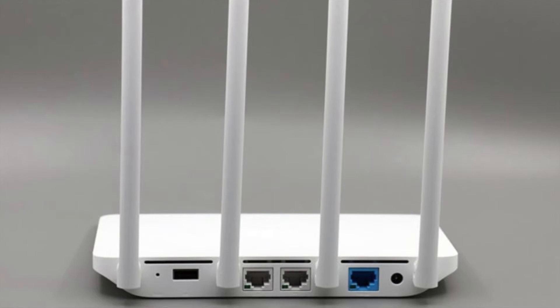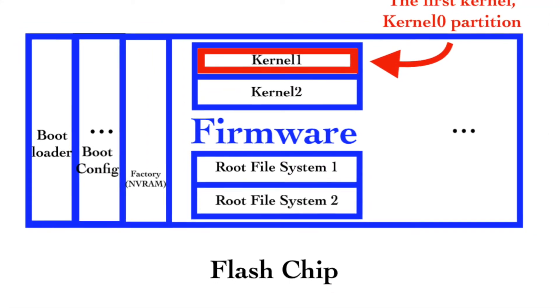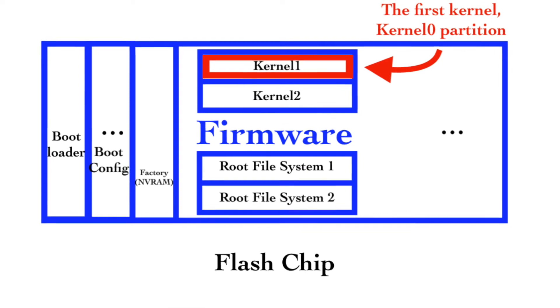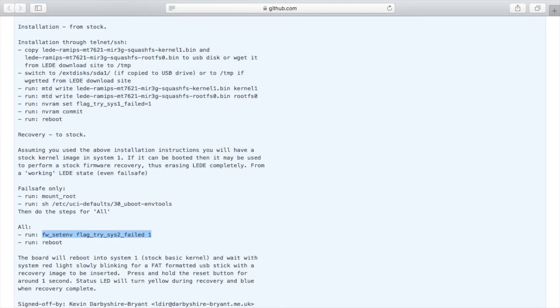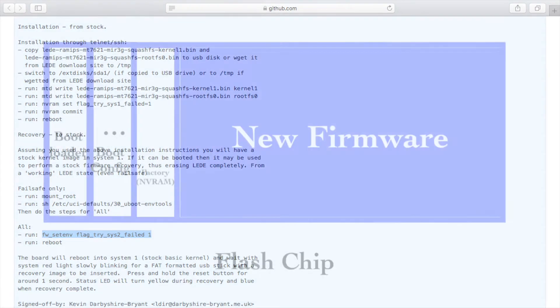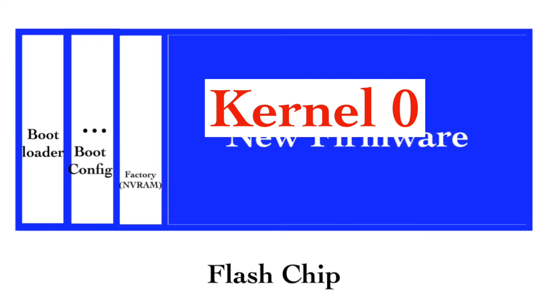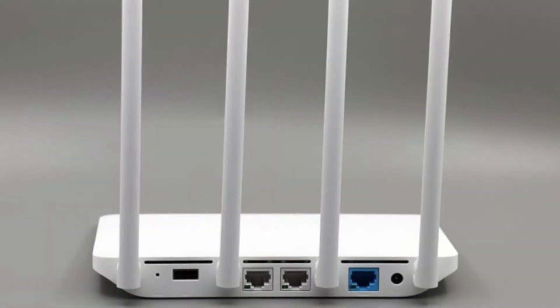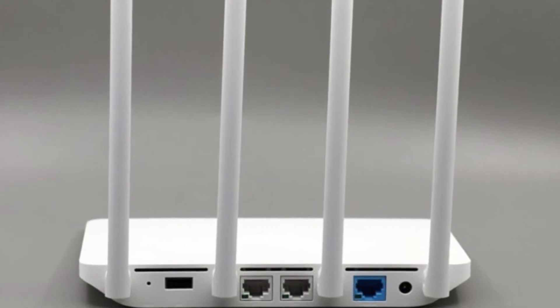But it's possible to go wrong for the WiFi Router 3 and 3G. The recovery mode of those two devices is in the kernel0 partition, not the bootloader partition. If you haven't installed third-party firmware, the kernel0 partition should still be there. Otherwise, you need to first have a functional kernel0 and add the environment variable to let the bootloader boot from the kernel0 partition before you can boot into recovery mode. This is risky — if you didn't successfully flash the kernel0, you likely won't be able to boot into a functional firmware to run the MTD command anymore. You lose the recovery mode, you lose the operating system — it's a brick. That is what I don't like about the MiWiFi Router 3: it's very easy to brick. Please be careful with the third generation of Mi routers.